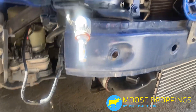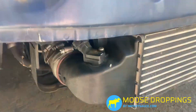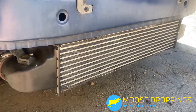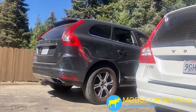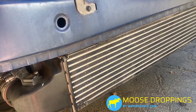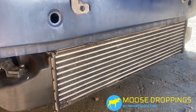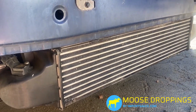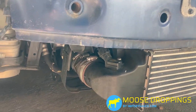On the P1s, the sensor is right on the cold side of the intercooler. Yours will have a little notch and a little base. This is the double-size intercooler upgrade we got — it's actually off the T6R designs. In terms of cooling capacity, it is almost exactly double the cubic centimeter cooling size of the original P1. Check that video — we noticed that our intake temperatures dropped to almost ambient, so you're getting a lot of cooling going on.